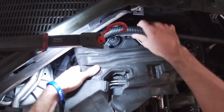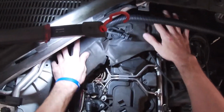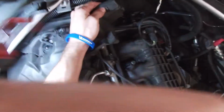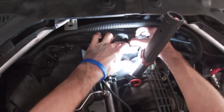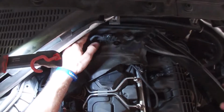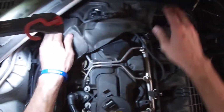And you can reinstall the foam insulation. You're going to want to make sure the mass airflow sensor harness gets fed through the hole in the foam. And then there's kind of like a piece right here that goes through the foam as well. And we can reinstall the engine over harness trim cover, lock it into place over there,